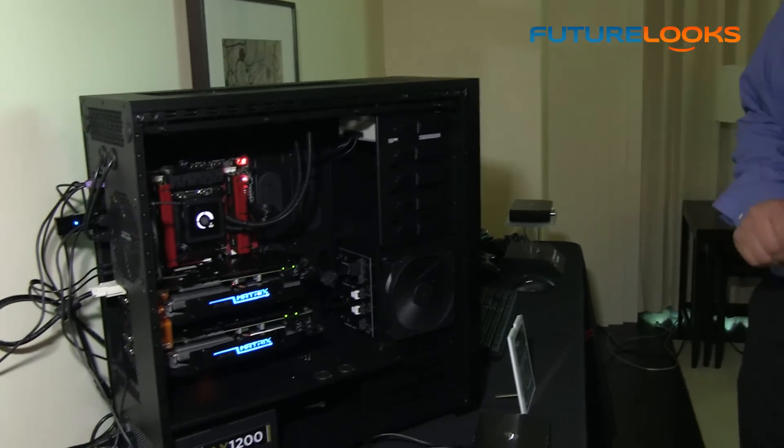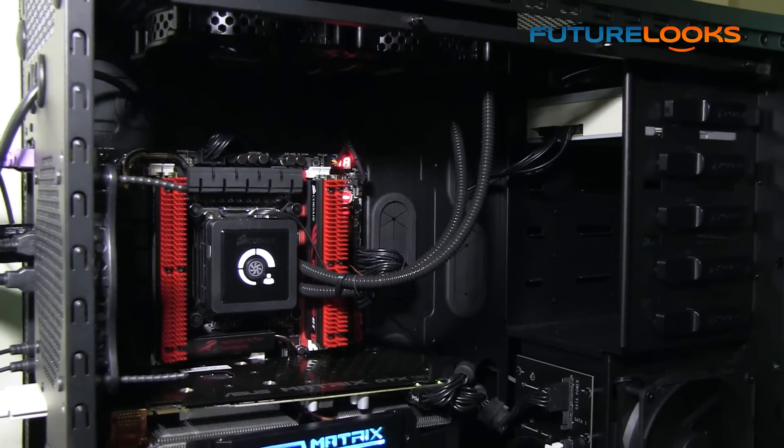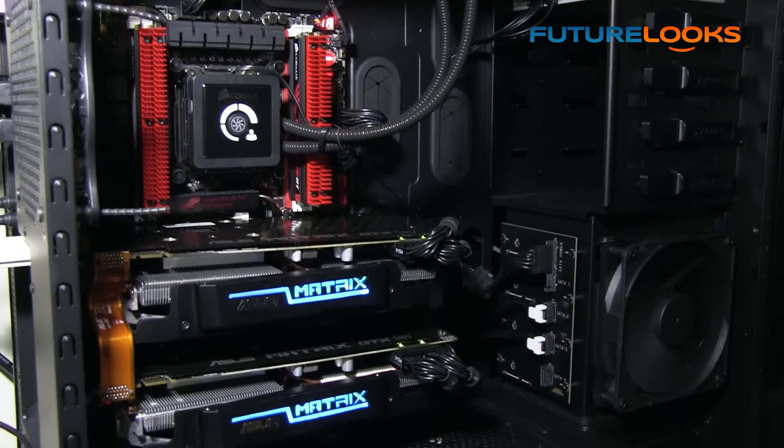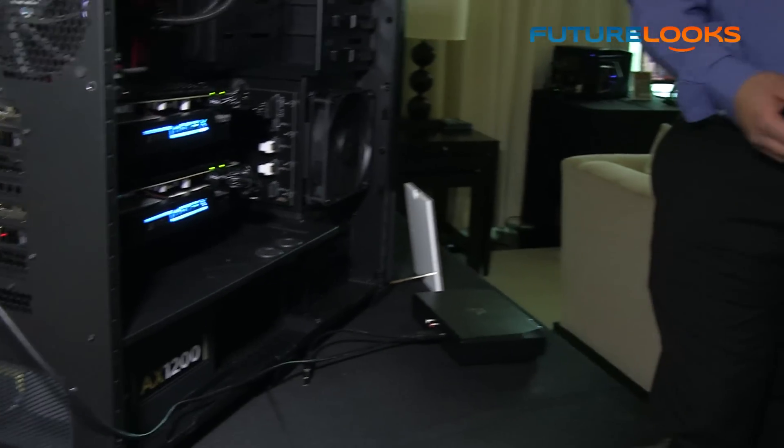There's also a feature around audio quality on the motherboard — we've done something that makes audio even better. We've done a complete rework of the audio design, referred to as a moat package design. We've completely isolated the PHY or codec package on a separate PCB layer from the rest of the motherboard. That minimizes jitter, improves isolation, and gives a better signal-to-noise ratio, allowing us to actually meet the maximum codec specification of 110 dB, even on a complex board with overclocking and multiple GPUs.